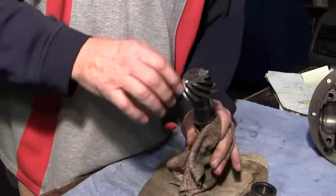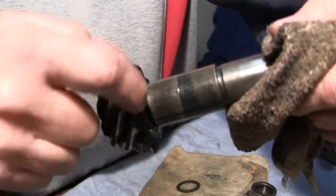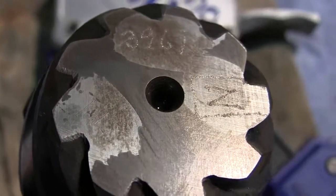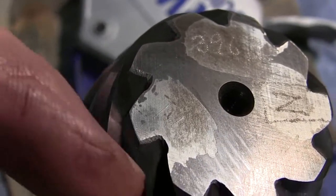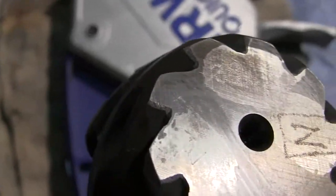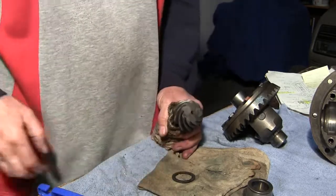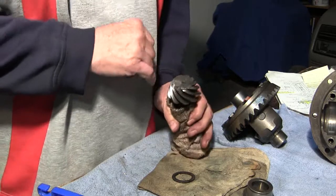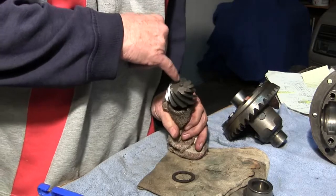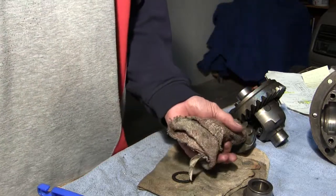Now the head spacer — ouch. Head spacer here, bearing here. This is the pinion head with the letters — here's an N, here's the number: 3961. Now it's evident — it's clear that it matches the crown wheel. This number 3961, engraved into the head, is the same number on my crown gear — 3961. So these are a matched set.